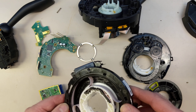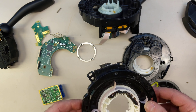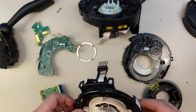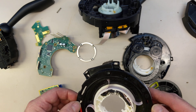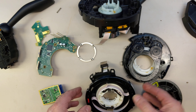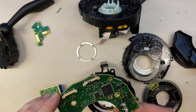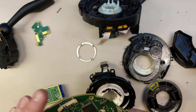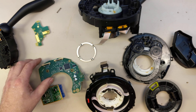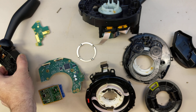This is one of many thousands of parts you would find in a Tesla or any other modern automobile these days, which gives you an appreciation for how hard it is to make a car. Because all this stuff is commonplace, and someone has to engineer all this. My guess is that this wasn't engineered by Tesla, despite having Tesla marks all over it, because it's kind of uncommon for Tesla to use a Japanese V850 processor — I haven't seen them do that in anything else. So I bet this is an auxiliary supplier that's good at this kind of thing.